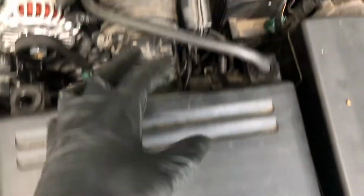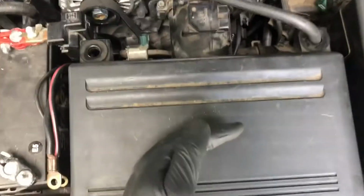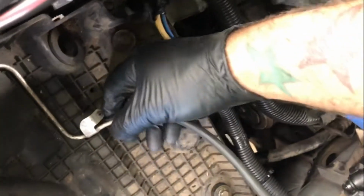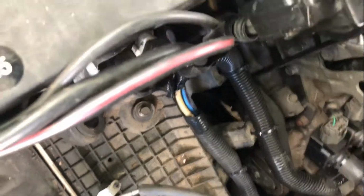but I'm gonna remove it from here to the front of this air box as one complete assembly, just removing this Phillips screw head. So I'm gonna go ahead and do that next, and that should clear this part out of here. Remove this one screw. As I removed the screw and pulled it back, there is a vacuum line up underneath this one. This is on a 6-port, so a 4-port might be different, but on a 6-port, you gotta remove that vacuum line, or you might break something when yanking this thing out. So that whole unit came out as one solid piece.